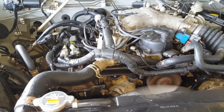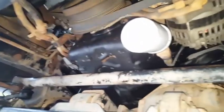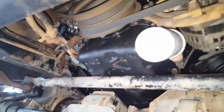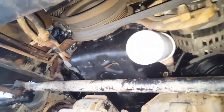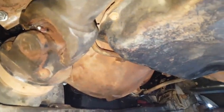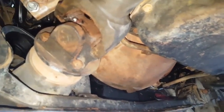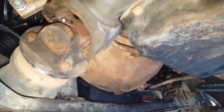Let's take a walk around under the vehicle and see what's going on. Since we have the header manifold installed, the exhaust will have a little bit of loudness. The oil leak at the crankshaft rear main seal has now been eliminated. Also, the transmission leak has disappeared.